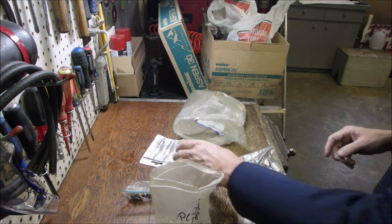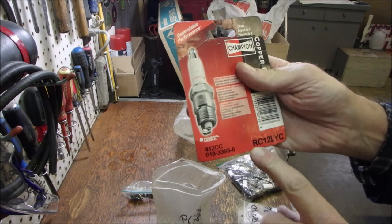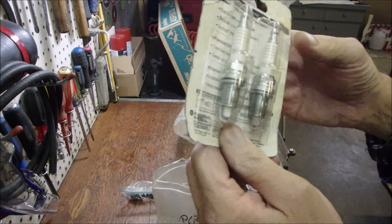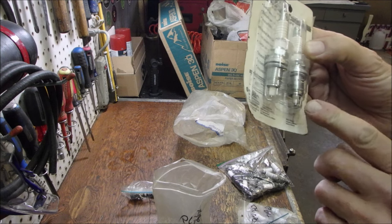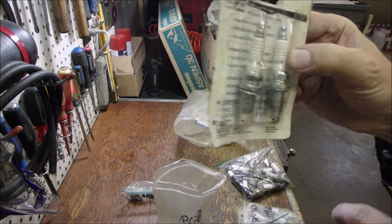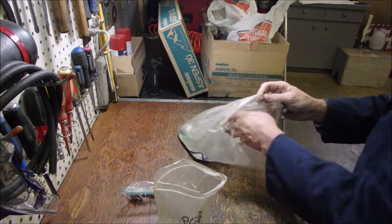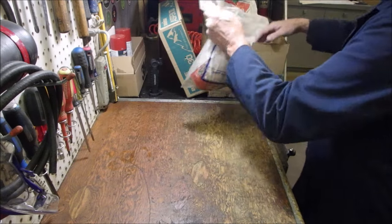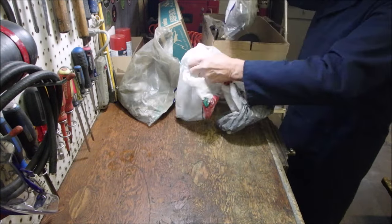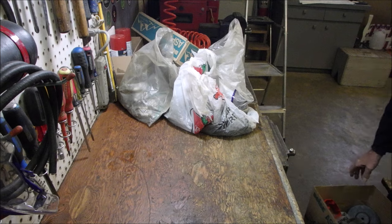So yes, I can get myself out of a jam. By mistake I got some RC 12 YC LYC — that's a longer insulator. If you put these in the wrong engine they will hit the piston, so I haven't really found a use for those yet. In the rest of this box that I keep the spark plugs in are chainsaw rewinds.